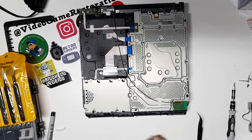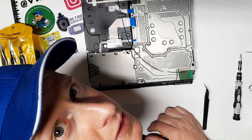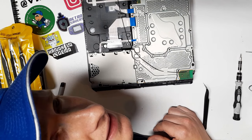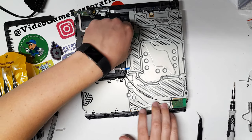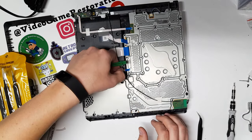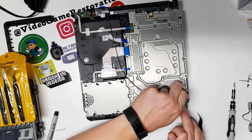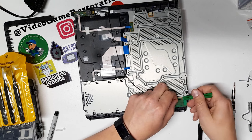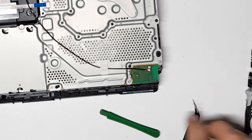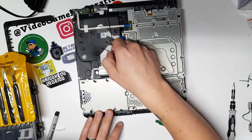I'm just going to take off some of this dust using my little plastic tool here, and I'm going to pop up these ribbon cable holders. I believe this one just pulls right out. I believe this one pulls out as well, and this one — so there's only one that was really being held in by a connector. Just gently rock those back and forth. This is just, I believe, an antenna — just gently pull up on this, you can even get a plastic tool and wedge it underneath. I try to preserve the sticker, but it's not a big deal if you rip it because you can easily replace it.